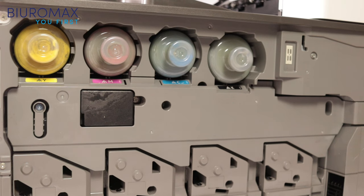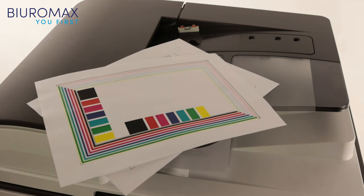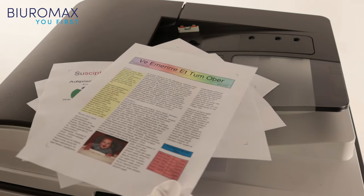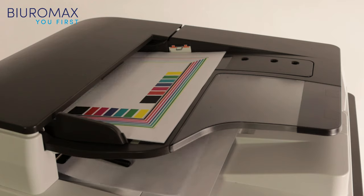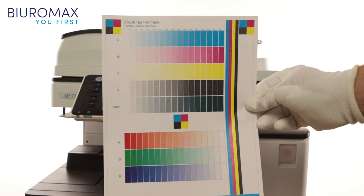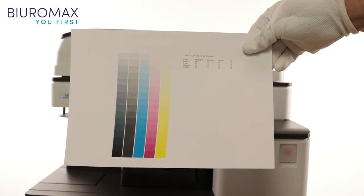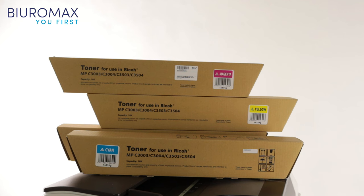The copier is equipped with a set of original toners, RICOH Type MPC-3503. We start the test by making 400 copies of specially prepared test sheets with 5% toner coverage. After 400 copies, test prints and demo prints will be made. Demo pages will be used for comparison after 18,000 copies. Original toners are removed from the copier and test toners are installed in their place.